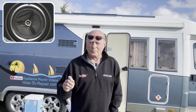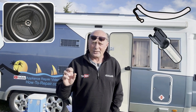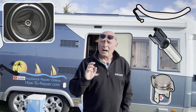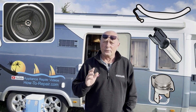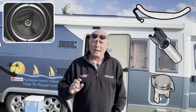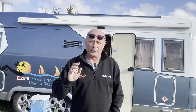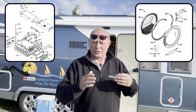Another reason the machine may be turning off is due to a humidity sensor — this can be an NTC sensor, or it could be a temperature sensor. There are many sensors on these heat pump tumble dryers that can cause the problem. Without having the machine in front of me it's a real hard one, but it's worth the effort of stripping the machine down and cleaning everything.